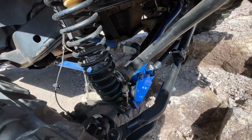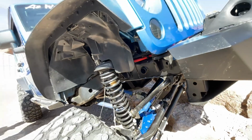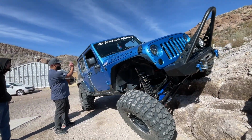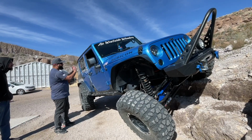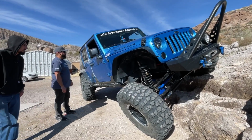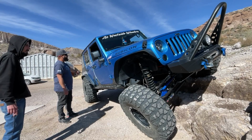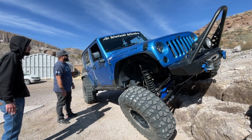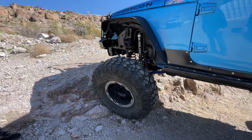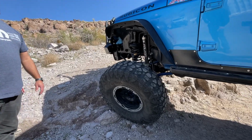Yeah, in the front, you've got a sixteenth on either side of that track on the top, on the brake line. You guys see the link is about a sixteenth on either side. So if you're stuffing this tire, you're rubbing the bolt on the brake line. I can feel it. I know the clamps look good. The steering stabilizer clamp isn't even close to the diff. I think you're good.